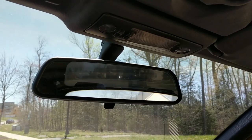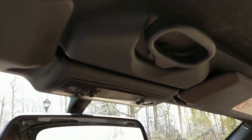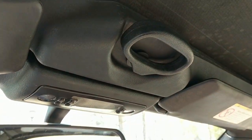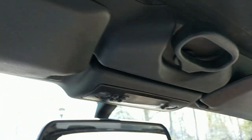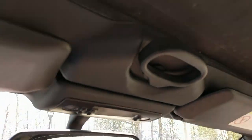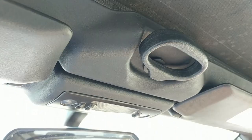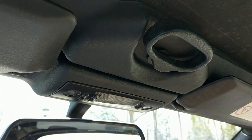So what you do is you stick a Torx bit in that little hole. You twist it clockwise. It's gonna take a lot of twisting because you have to unwind the hooks slowly. It's a slow process, but you have to unwind the hooks and it'll slowly disconnect the top from the windshield. All the directions for that, I'm gonna list below.